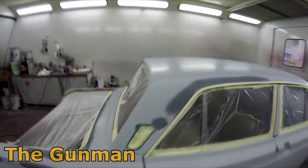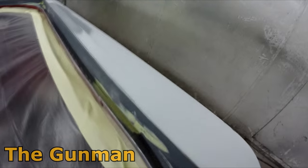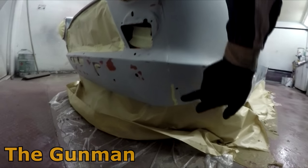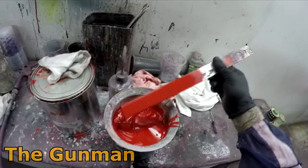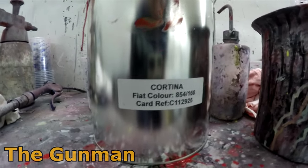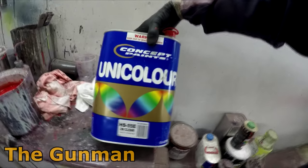The GP1 is the air cap. It's all been prep-solvent cleaned and tack-ragged — I went over the entire thing twice and I'll probably give it one more pass just to be sure there's no dust left. There are just a couple of little spots where I put some seam sealer — up here and in here where the seam was after I removed the rust. Same thing on this side — a little bit of cracked old seam sealer through there, so I treated that. The colour here is the Concept Paints base coat. It's not a factory colour from the Ford Cortina — we found a colour card, got a reference number, and it came up as a Fiat colour. We're using the HS 55E 2K clear coat.